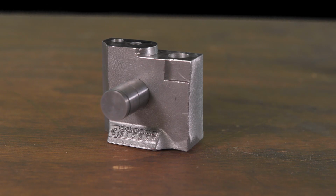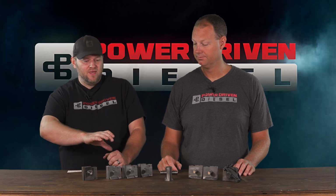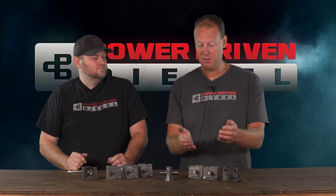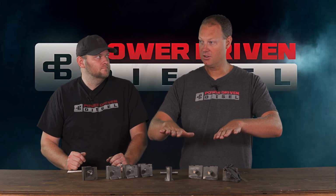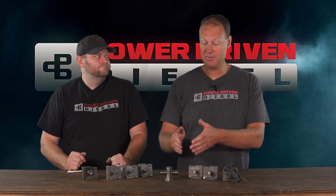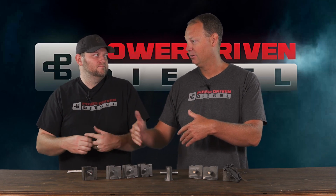So they have a widened base. The base is almost twice as wide as stock. Not quite, it's like 44% wider than stock. So that helps with the rocking motion, because the head where these things mount is actually wider than the base of this. So there's room to widen it, to catch structural support. Different head castings are a little bit different, so this may hang out over your head, but it'll definitely get to the edge of any head we've seen.